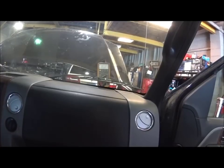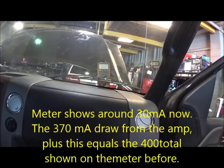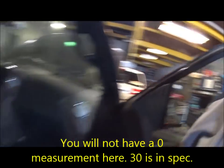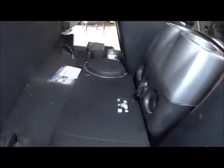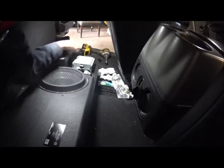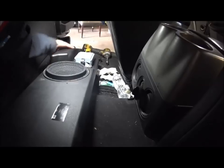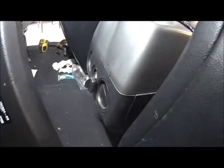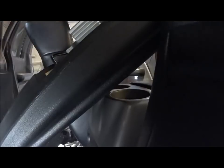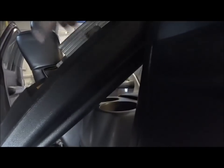Look at that — there's no more drain. There's your short. That's it: once unplugged, the draw is gone. That is your subwoofer amp, which is shorted. Like I said, this thing is warm to the touch, and I saw it through the thermal camera.